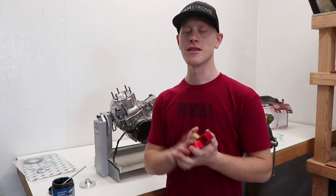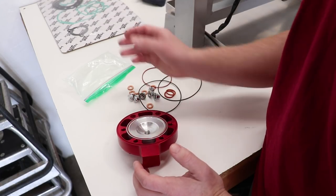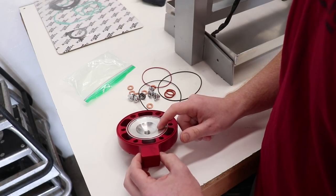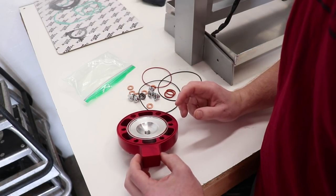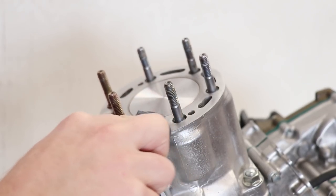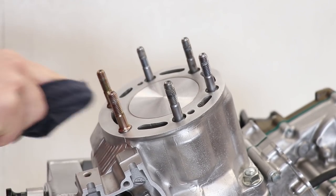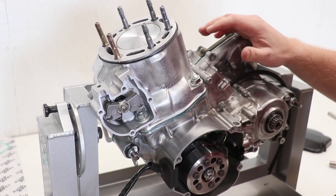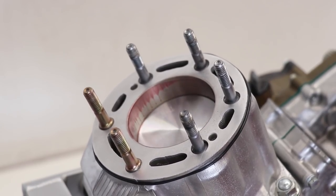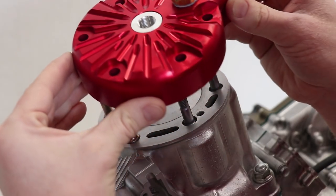Let's get this head mounted up on the engine. Fathead supplied some o-rings for the dome and the head — I'll get those in place and mount the head. This style of head uses o-rings instead of the traditional style metal gasket. I'll be going with the stock compression ratio dome to eliminate any issues from the get-go. Fathead supplied new nuts and washers for the head as well. For the cylinder surface I'm wiping it down with acetone to make sure there's no oil or assembly lube left over — you don't want any grease on that gasket surface. And one more thing before I put the head on: I'm making sure the engine turns over without any issues, just seeing that the piston goes up and down in the bore without catching on anything. All looks good.